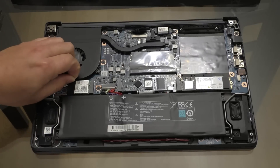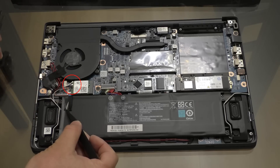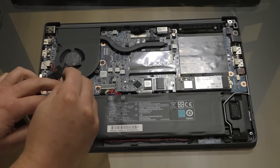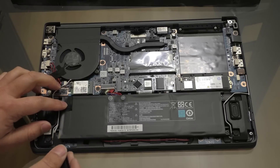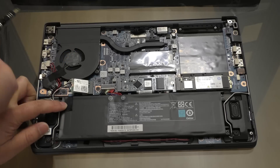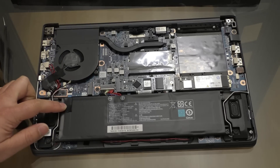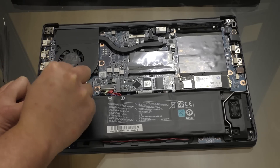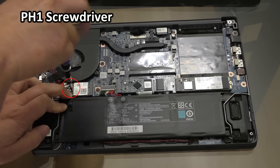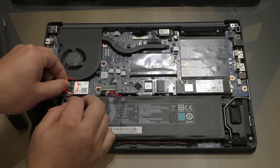Lastly we have our wireless card. For this one we're going to have to peel back some of this tape. You can see we have the two antenna connections as well as another Phillips screw, so we'll go ahead and pop those connections off first. Remember the white one goes on top and the black one on bottom. Then we'll undo the Phillips number one screw, pull this card out, take our new card, align the slots and tabs, place that in, make sure it's seated, then rock it down and replace the Phillips number one screw. Then plug the antenna back in — white on top and black on bottom.